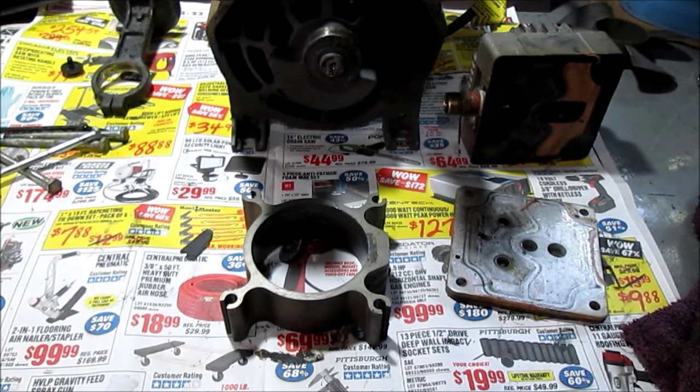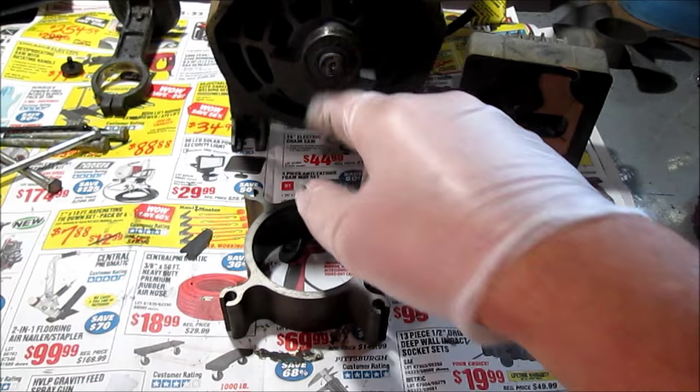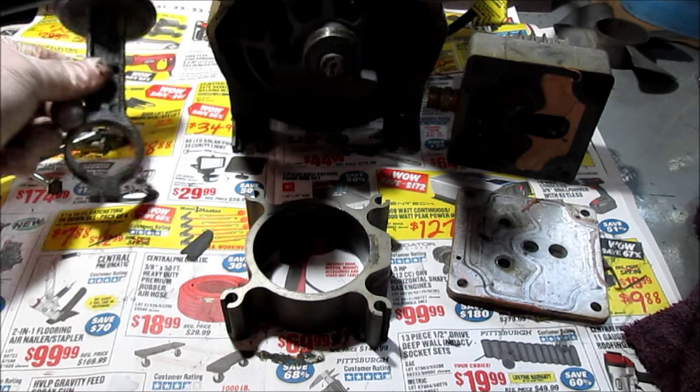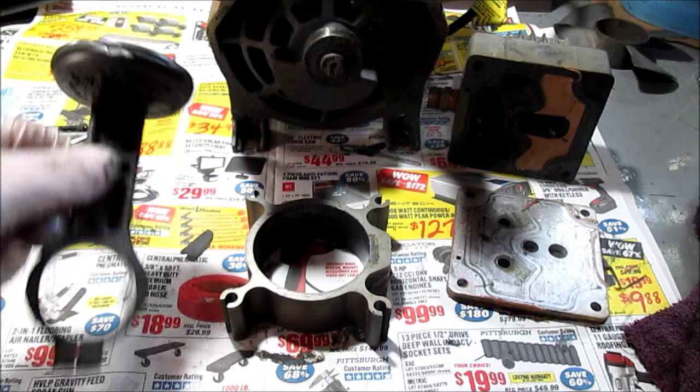So there you go. I'll include a couple of photographs. Kind of give you the basics of how one of these works and what it takes to rip everything off it. Pretty simple — four bolts, take your rod loose. Take your fan off. Take your rod loose with that split in it. You want to put a screwdriver or something there and wobble it off the bearing. There was your fan. There's your problem.